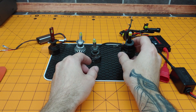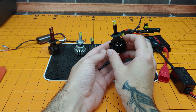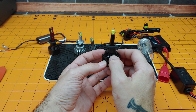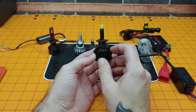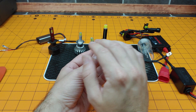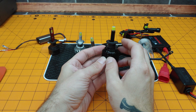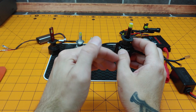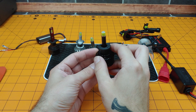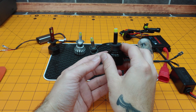My preferred choice of LED is this SND H1, available on eBay. The full review on this bulb will be in the description below. This one was drawing 29 watts and had a very even brightness across the top — really the midfield brightness — and the lower area closer to where the vehicle and the ground meet was a respectable average of about 220 lux.